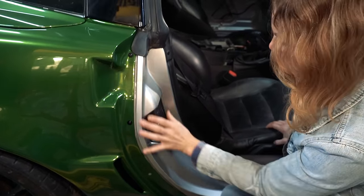I tried to weld it back together. Oh, it looks like we've got 3 bolts over here, 3 bolts over here, and then we got to remove the belt tensioner. If you guys are doing a job for the first time and you don't have a book and you don't have resources, just pull the new part out. You can see exactly where the bolts are, because when I'm looking down in here, I can't tell what's bolted to the water pump, what's bolted to the head. But I can look right here and be like, all right, cool. 3 bolts, get those out, water pump should be loose.